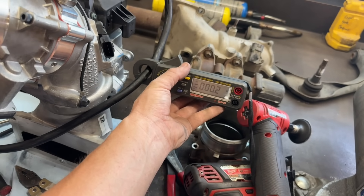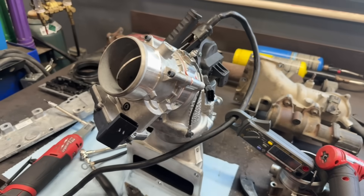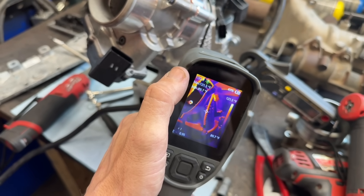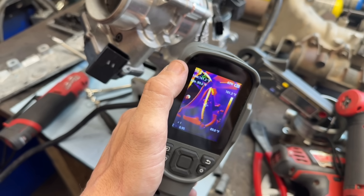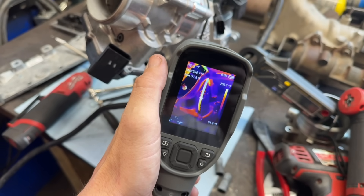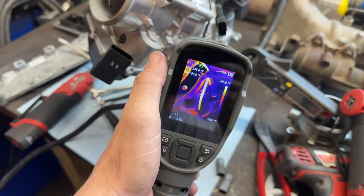Go ahead and touch it for just a second. We're good on our 50 amps — we're carrying current. You might think that's sufficient, but watch this. This intake heater can stay on for quite some time. Look at that wire starting to glow. We're already over 100 degrees. The high temperature here is at 200 degrees. That wire is 215, 220, 230, 250 degrees.